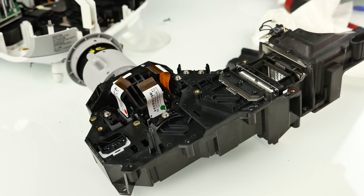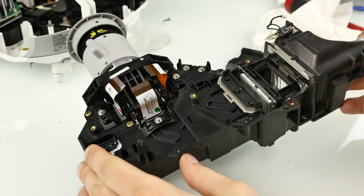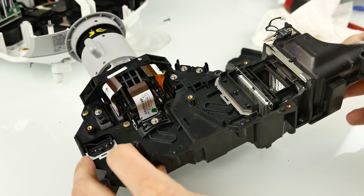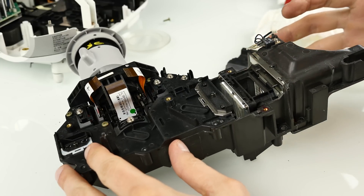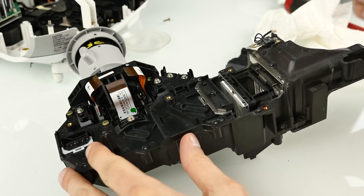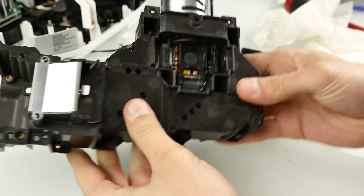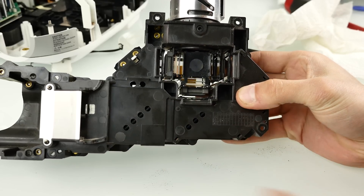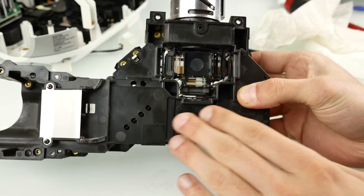I've now taken out the main optical unit. Let me give you an idea how such a projector works. This is actually a three LCD projector — that means we have three little tiny LCD displays inside. Basically the light from a strong light bulb makes a white light beam. This goes through several mirrors — you can actually see them here at the bottom. Light consists of different wavelengths reflecting different colors, and the light beam gets separated into red, green, and blue.